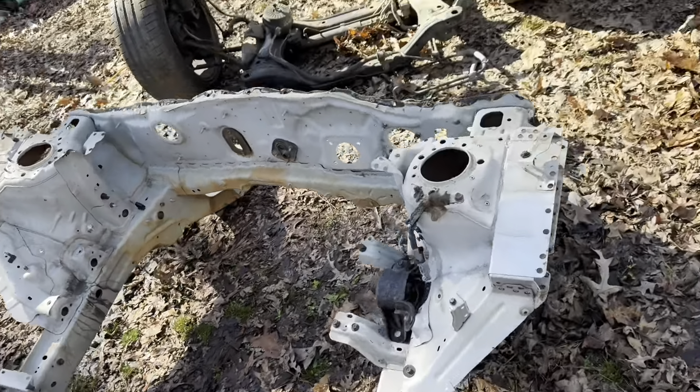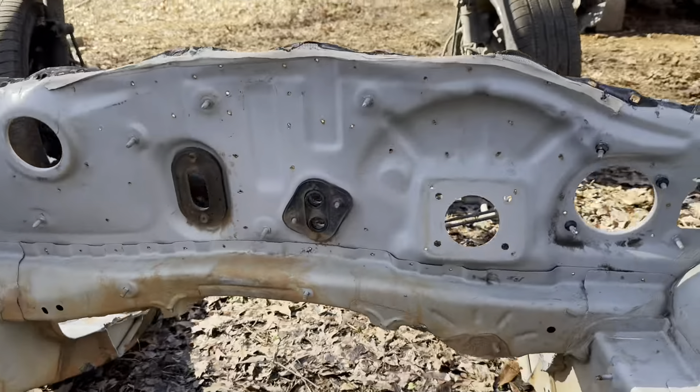It's the next day. I got the center of the tunnel cut out. I've got just the front of the firewall, and I moved the front subframe away from the car. I'm going to test fit the subframe to the front half of the Veloster frame and see where everything lines up — see if I've got enough room with the firewall for the engine to fit without hitting anything. That'll determine where I can go with the Veloster firewall. As long as I can get the subframe to fit inside the frame rails front to back, I'm not worried about side to side because that's what the Genesis frame rails are for. I've got the entire front part of the floor cut off and the bottom section of the floor cut out.